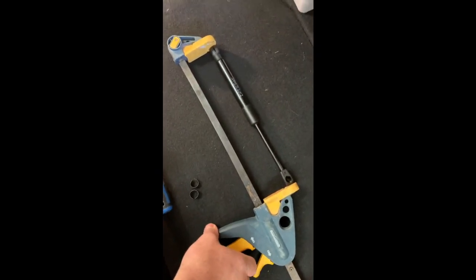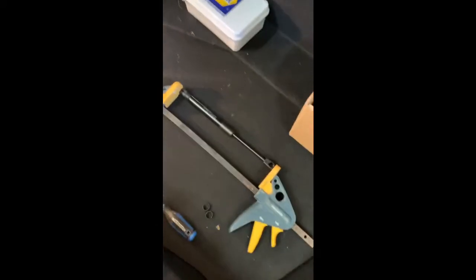I use this clamp in order to compress the strut. The new ones can be put on with the strut — the strut is probably about half an inch longer than it appears is needed. Just compress the strut until it lines up, and gently just snap it into place. It goes on very easily.